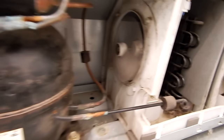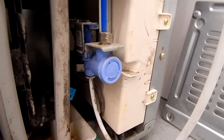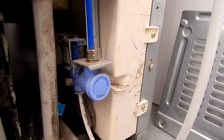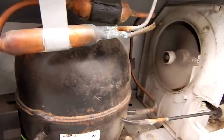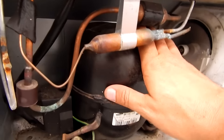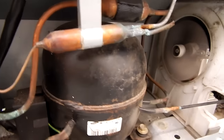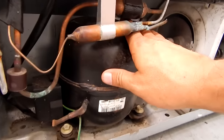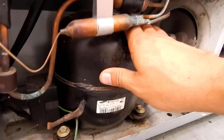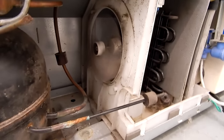Here's a look at the compressor and the compressor fan, which is running. Right here we have the blue water valve, and this big white box is what hides the control board — that's what we're going to be taking out. An easy way to tell if the compressor is running or not is to put your hand on it. Right now it's just warm, not as warm as it should be if it were running. I don't feel any vibrations; it's perfectly still, not vibrating, not making any sounds. So I'm sure the compressor is not running, and it should be because the fans are running and the temperature inside the refrigerator is getting higher.